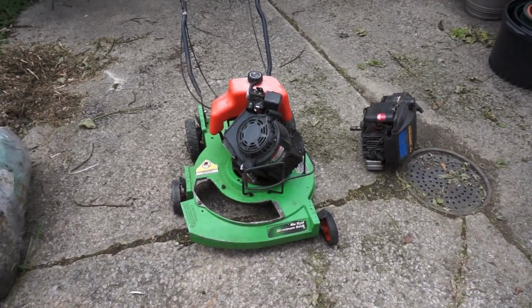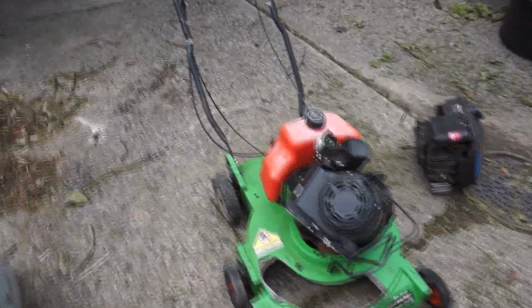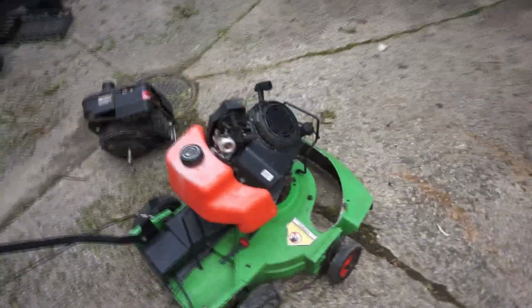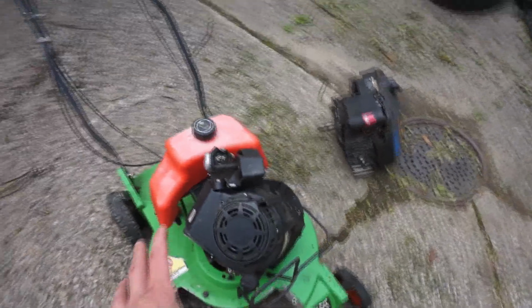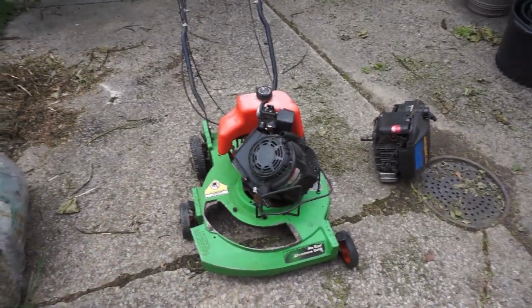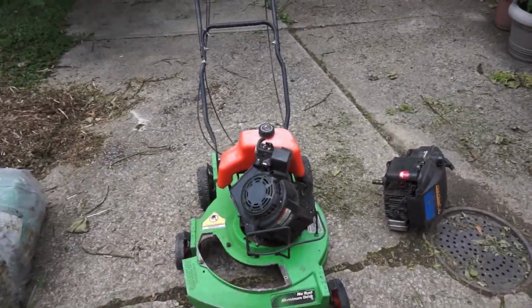So this is a Lawn Boy commercial. A very late model. I believe it is a 22243. You can see that right there. 22243, which means it has the Briggs & Stratton 6-horse engine, which was sort of Lawn Boy's last gasp at an old-style mower, but with an engine that sort of met emissions regulations and some other things.